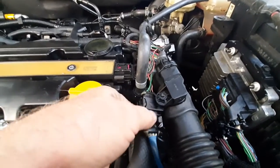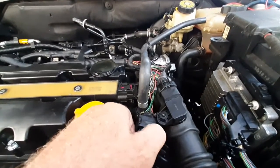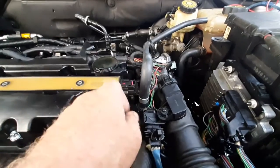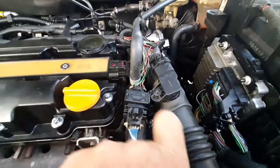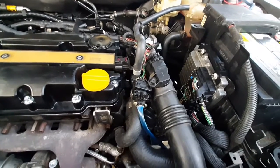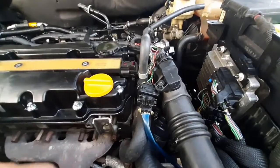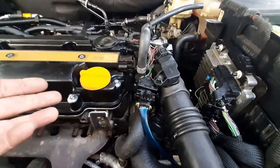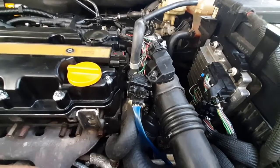Apparently this has happened more than once if somebody else had put a video out about it. So check all your other stuff first — or actually, look at this first, especially if somebody has had the engine apart or you've been working on it. Make sure these are on right: square plug on the oxygen sensor, oval one on that pressure sensor, because that will save you a lot of trouble. I've given my daughter a lot of crap about this because I spent several days trying to figure it out, but I can't be too hard on her because I'm horrible about ripping a wiring harness out and figuring out where it goes back. Normally the plugs don't interchange because they're the right length to go to a certain area, but in this case they're right in the same neighborhood and the plugs will interchange. Well, that's all for that — I hope that helps somebody. Thanks for watching.